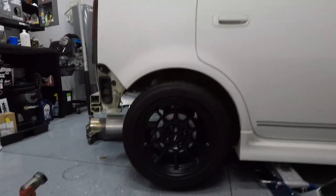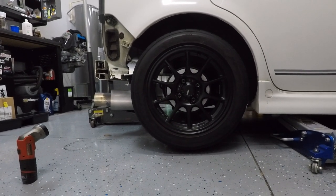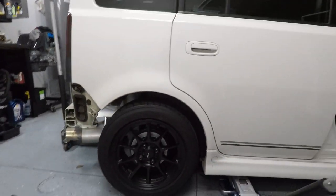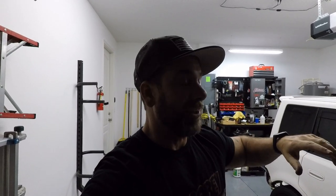As I'm rethinking this install, I'm thinking maybe I shouldn't have any drag at all on the wheels, because when I apply the brakes they're going to expand and having drag on it might be a bad idea. We're going to go inside and make the adjustment at the e-brake. I've got the wheels on — what do you guys think of the drums? I think they look pretty cool. They're definitely going to help the wheels pop a little bit in the rear, just like the front did with those silver calipers.